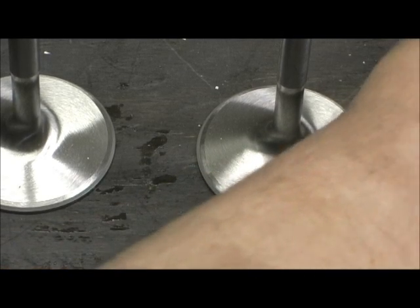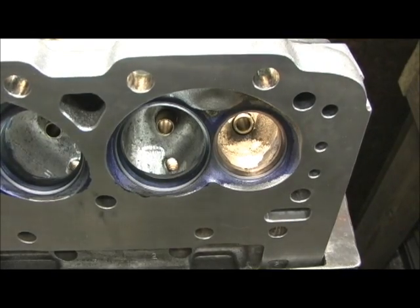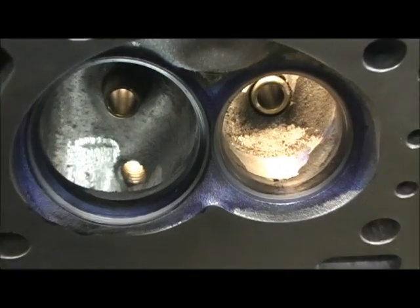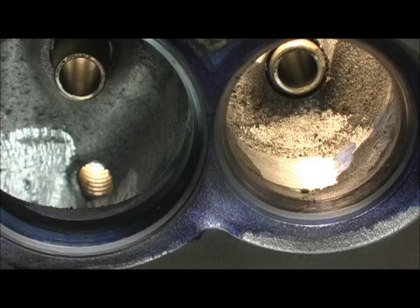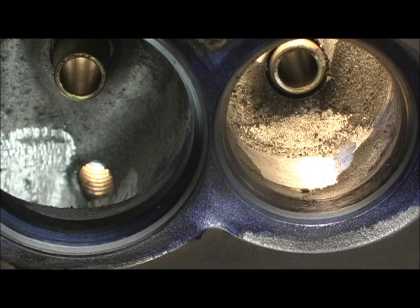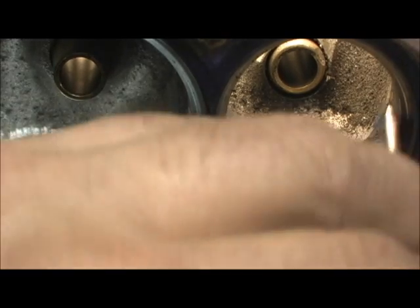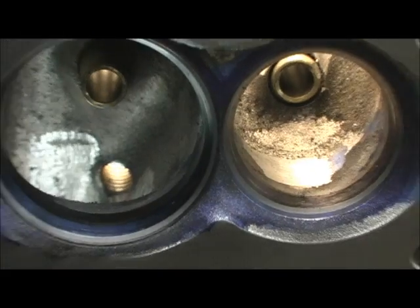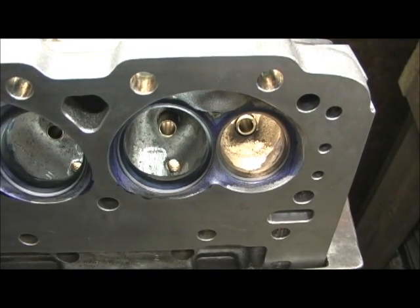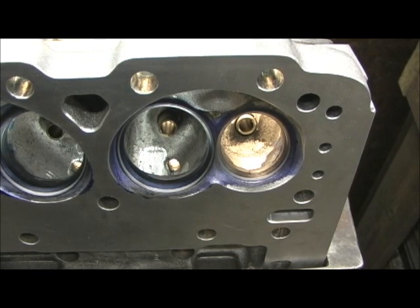Now that I've got the line scribed, I think you can see the line pretty well on the exhaust side — there's our line. On the intake I can see it good too. I'm going to show you how I go in there with a pineapple and pull that in on them. Stage two is basically going through making sure all the stuff is there with just a little bit of touch-up. I'll tell you why it's a 2.5 in a minute. Let's go ahead and get the last part done.